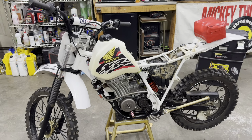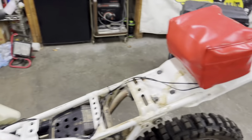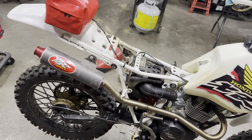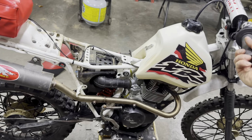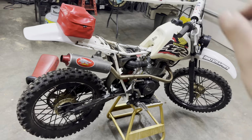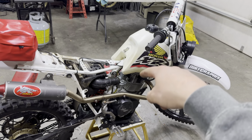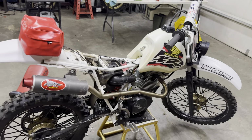Oh yeah, she's back in action, guys. Got her warmed up on that 22 mil Mikuni. That's what she's supposed to sound like. So obviously that intake is working good for us. I will say, we did have to modify that to make it work how we wanted it to.